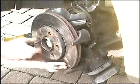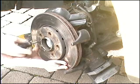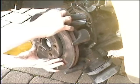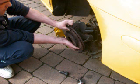Now the brake disc can be removed from the hub. Simply locate the retaining screw and remove it. In some cases you may need to hit the back of the disc with a mallet to remove it from the hub. Ensure there is no dirt or rust on the hub itself. The new disc needs to go onto a clean hub. Any dirt between can cause brake judder or uneven braking.